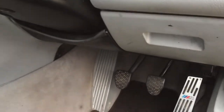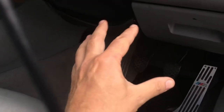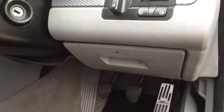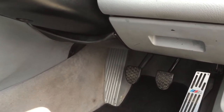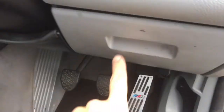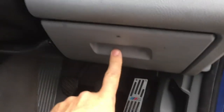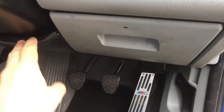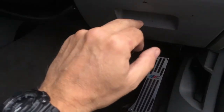On a right-hand drive car the method of getting the FSR out is very different from a left-hand drive. With left-hand drive you have the glove box here and it's a simple case of taking it out, which gives you lovely access into the center console - making the job quite a few factors easier. On a right-hand drive, you actually do need to take this part out even though you might think you don't.